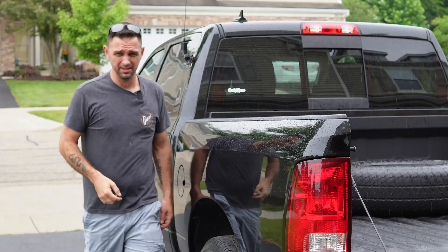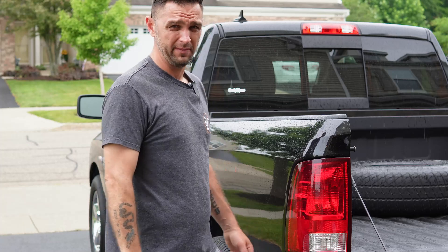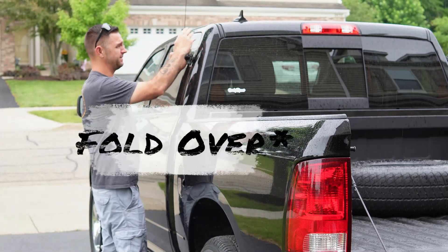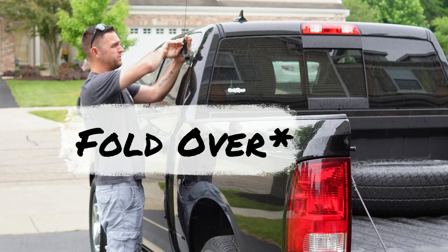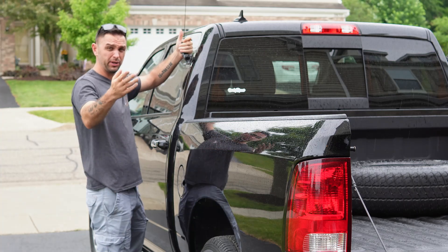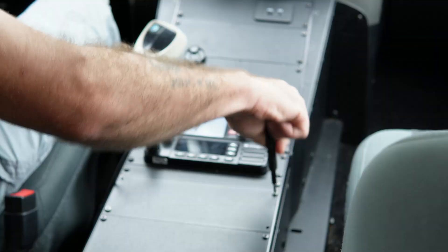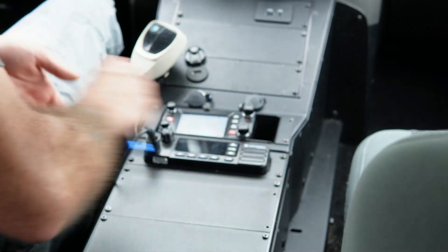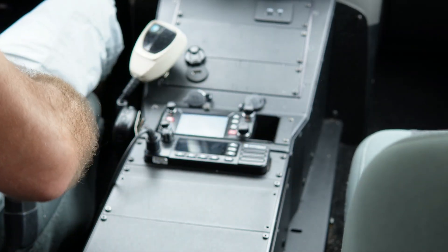The total length is about 34.5 inches, and this antenna does not have any kind of fold-down system, so if you go into a parking garage you'll have to remove it entirely. For those inquiring, I'm using the Motorola XPR 5550 and the Yaesu FTM 400 in this setup.